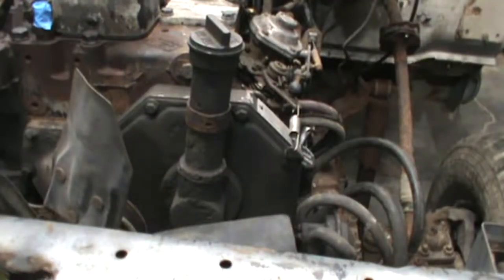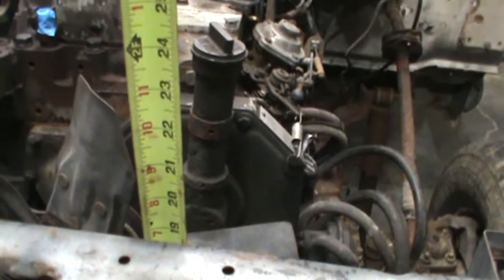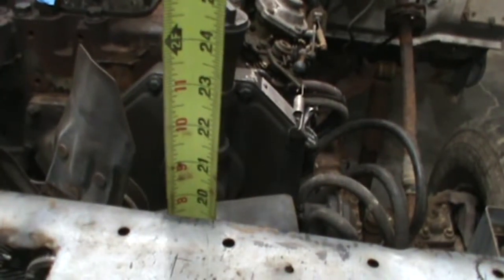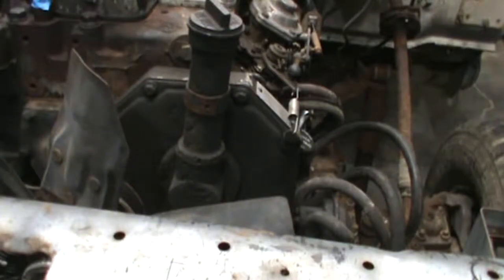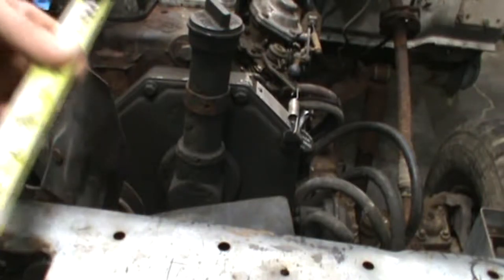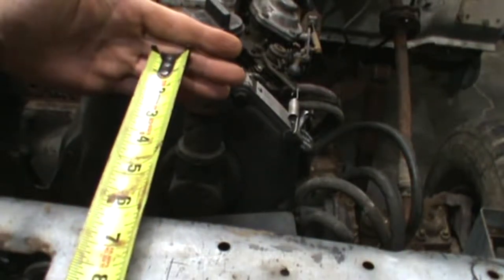To give you an idea of the other dimensions: this radiator is 23 inches tall, so it's going to be a little over three inches higher than your front grille support. It's also six inches deep, which puts it right there with the fan. As you can see, the Mishimoto radiator is not going to work for the first-gen, at least not the way it is right now.